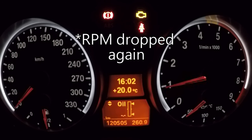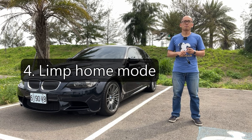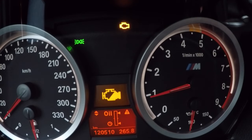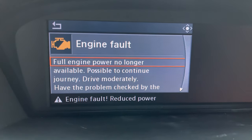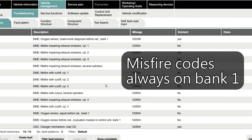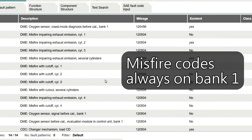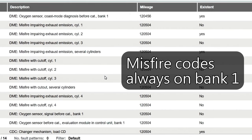The whole car was shaking badly. And number four, eventually the limp mode or limp home mode. You will hear a warning gong and an engine icon on the instrument cluster. The rev limiter marker reduces to 4000 RPM. The infotainment system display will show reduced engine power. If you look into the codes, the fault codes show misfiring, misfiring with fuel cutoffs, or misfiring on several cylinders from cylinder number one to cylinder number four.